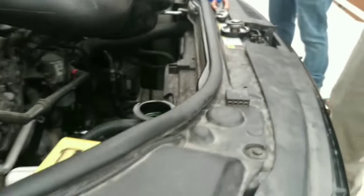If you don't bleed the system, the car is gonna overheat. So make sure that after you drive it, you let it cool off, open the bleeder valve, and open the radiator and put more coolant. Make sure the system is completely full. Basically, you just have to let all the bubbles come out. When you see water and bubbles, it has to be straight water.